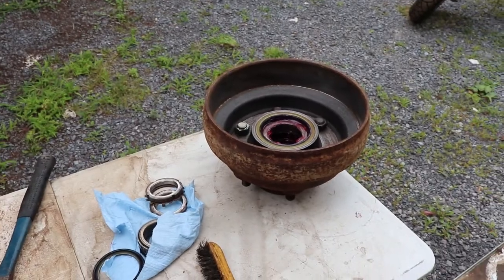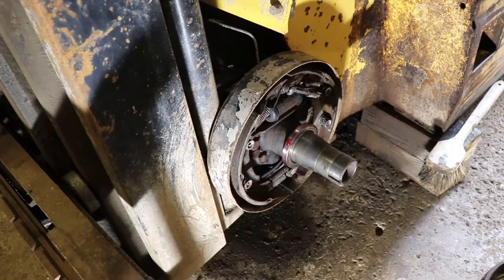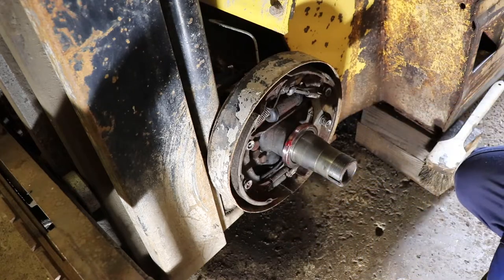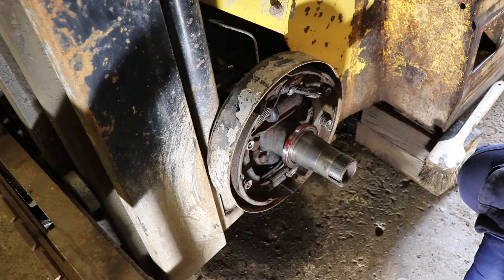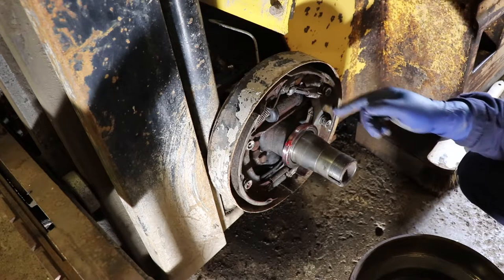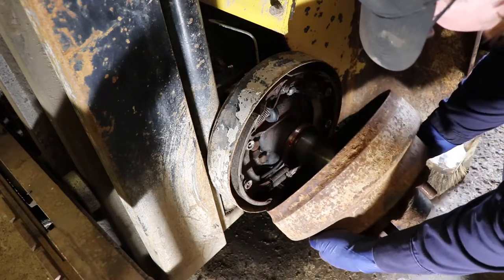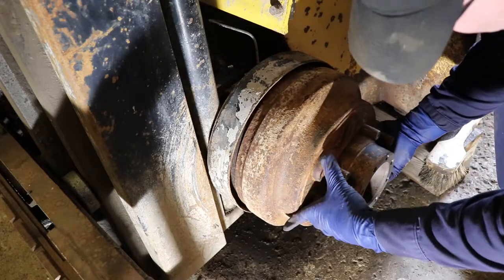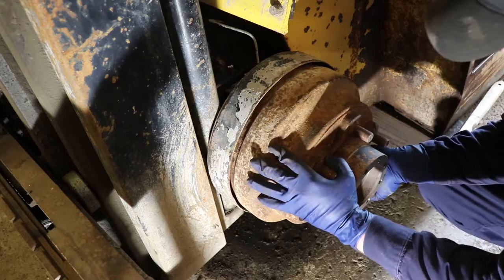At this point it's best to toss the brake drums and hubs onto the vehicle. You might want to measure your brake drum and the width of your brake shoes, but there is a rubber plug, just like a car, that you can use to adjust the star wheel with the wheels on or at least with the drum on. The most important thing is to put a bit of grease on the bearing surface and not damage the seal when putting this on. Line things up carefully - you may have to adjust the brakes just to get this on.